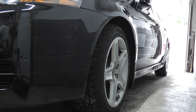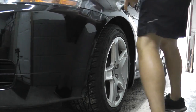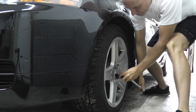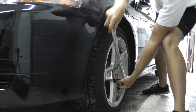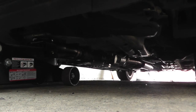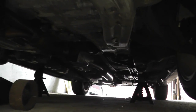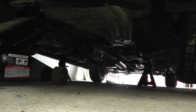If you're familiar with this channel, you know that I always use just basic hand tools. I have a breaker bar with a 19 millimeter socket to break the lugs loose. I'll be jacking up the vehicle from the front crossmember, which will allow both front wheels to come off the ground. Then I have two jack stands along both frame rails and lower the jack.